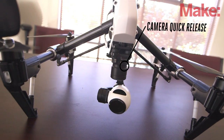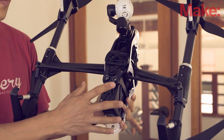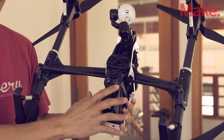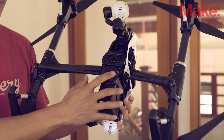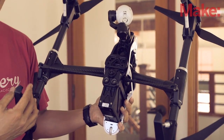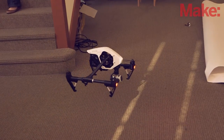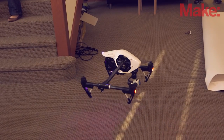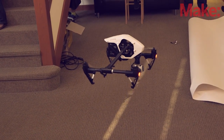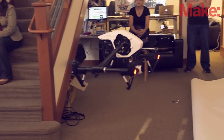There's a new sensor package here on the bottom. This is our optical flow stabilization system, which includes both ultrasonic send and receive, and an optical flow camera. What that does is essentially allow the Inspire 1 to stabilize itself even without GPS positioning. So if you're flying indoors, or flying at low altitudes, or say under the canopy in a forest, you'll still be able to fly in a stabilized way with position hold.